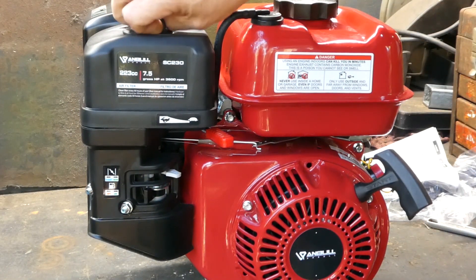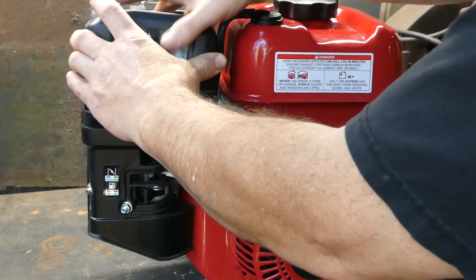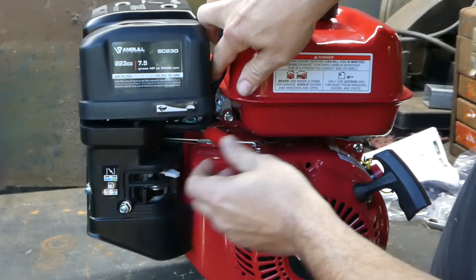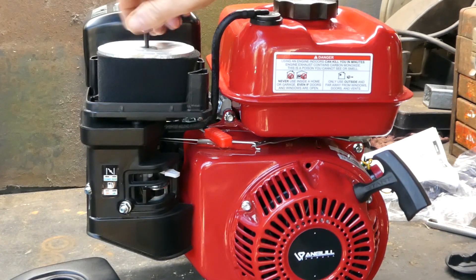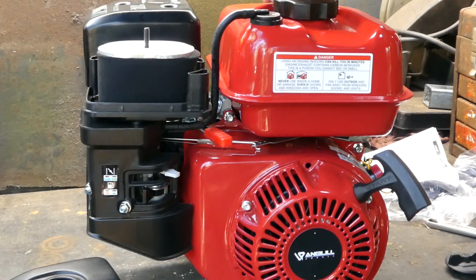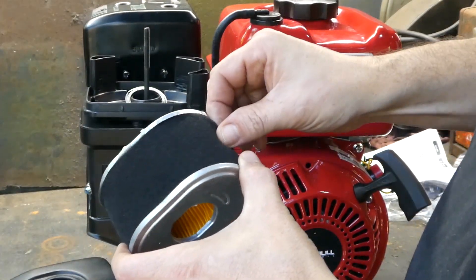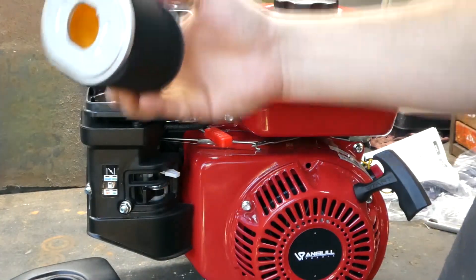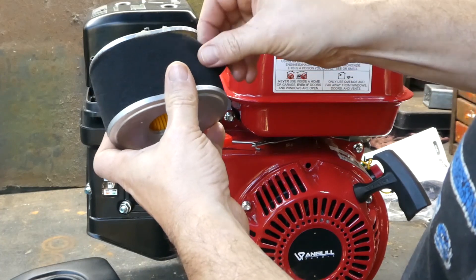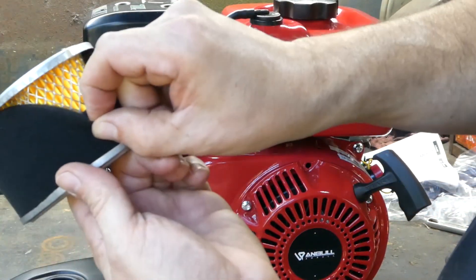Let's take a look at the air filter. This will be an oiled air filter, so it should have a very light coating of oil on it. This is plastic, but that's pretty much expected these days. It's got the little vent tube stuck in it. I have not looked to see if you can get replacements from the company or if this is a universal — I imagine it is a universal, you just have to find out which one. Yeah, it's got a little bit of oil on it, not a lot. But this is washable — you can take the foam off carefully, wash it, and then blow out your filter element underneath.